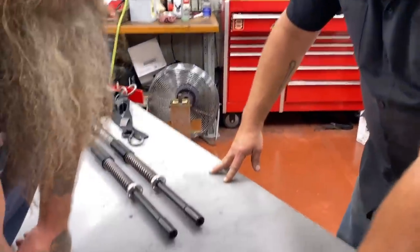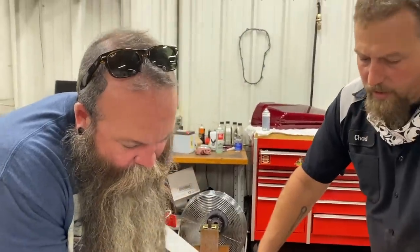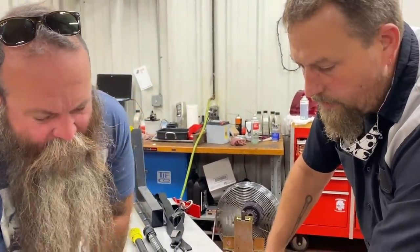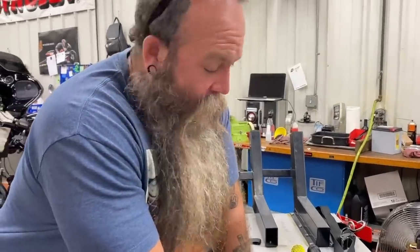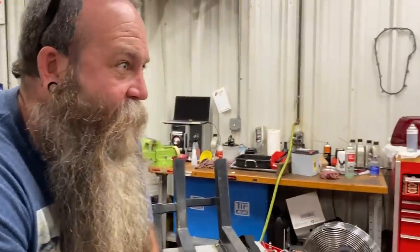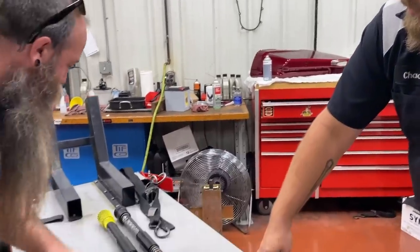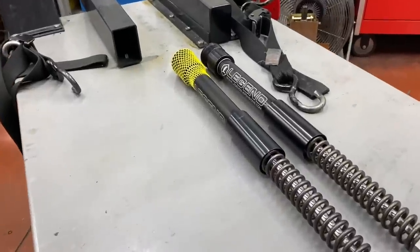If you look at the chart, it's rated out on weight. Our common weight is zero or one turn. You guys do a lot of two-up riding, so that's going to put you in that range — about one turn, just a little under with your setup. I'm also curious to see what that front end feels like, because right now it'll dive on you. Get in traffic, somebody cuts over and you hit the brakes, you'll feel that dive. Well, if it changes anything like it does on the back, it's definitely going to change in the front. I'm excited.